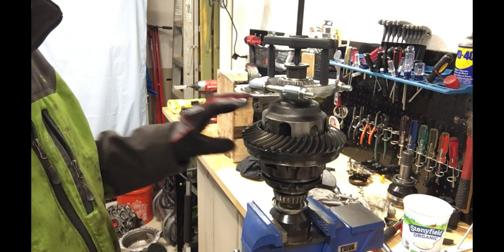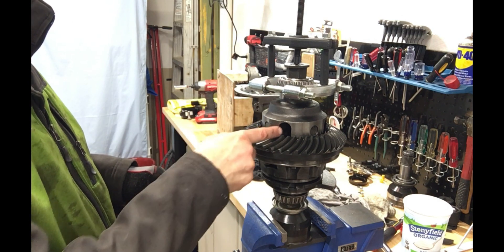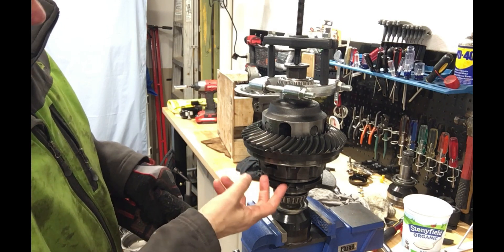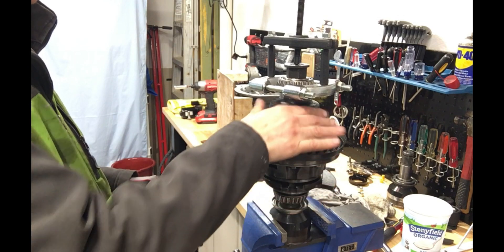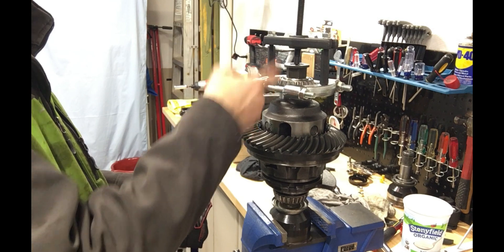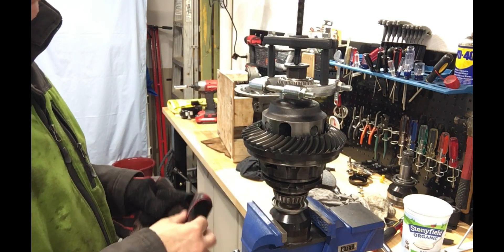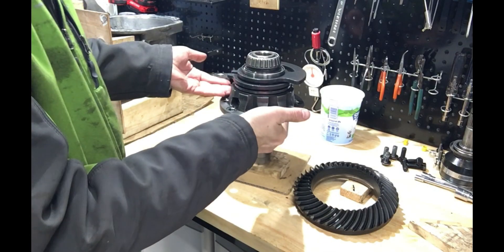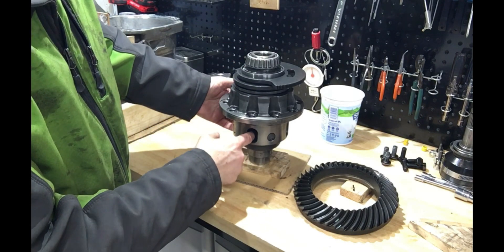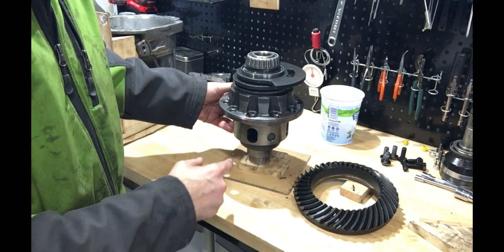How do we take the carrier unit apart? I think I have to take the ring gear off to separate the top hat from the main part of the carrier. But to get the ring gear off, I have to hold the unit and torque the bolts, and to hold the unit I have to grab down here where the bearing is. So: bearing off first, hold the unit, untorque the bolts, remove the ring gear, then remove the top hat screws and lift it off to inspect the top half. I don't think there's anything wrong with the bottom half — it's just differential gears.